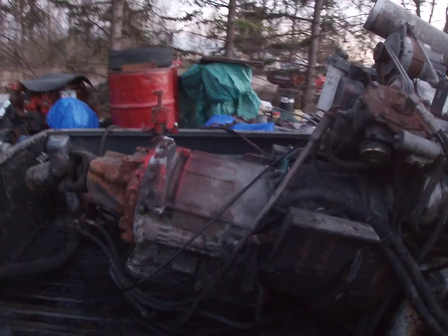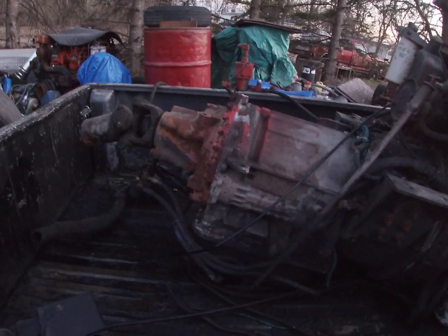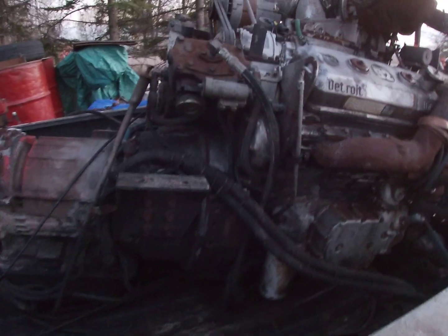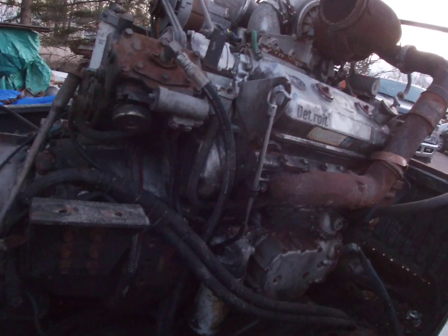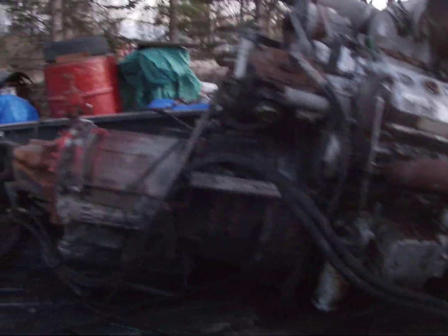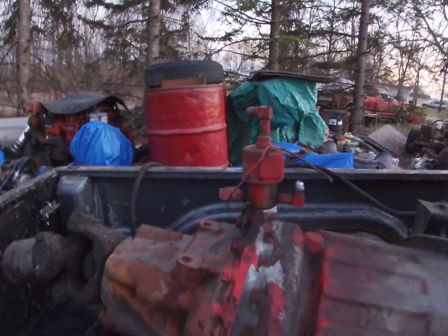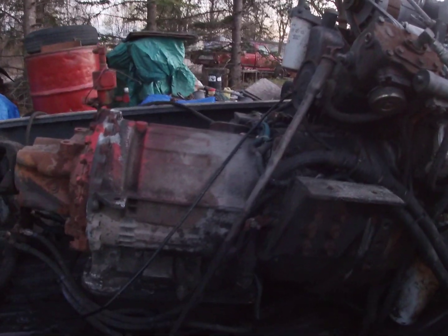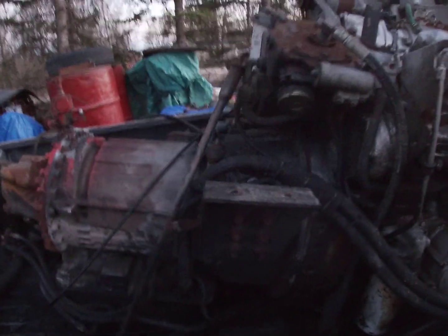I'm leaving the 3-speed auxiliary transmission that's in it, so I will have an overdrive, I guess you could say. I don't know what it's going to do for my speed in that truck, but that wasn't a high turning V8. There's that solenoid I'm talking about, and I'm pretty sure that was for directing oil to the bearings in the PTO when the PTO was on. I'll do some digging on it, but I'm pretty positive on that.